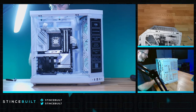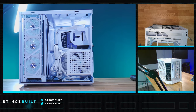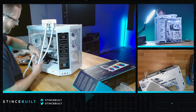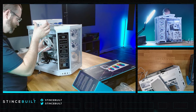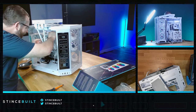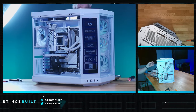Cable management in the back is getting done - keeping everything super clean. Taking off the fan covers. Now the rear fan - a 140mm going in the rear exhaust. All right, spinning back around. Everything's in; now working on the cooler. Moving the obstruction out of the way - pre-applied paste is perfect. Routing the USB controller cables - AIO fan and CPU fan headers connected. Lots of space in this case - it's looking really good.